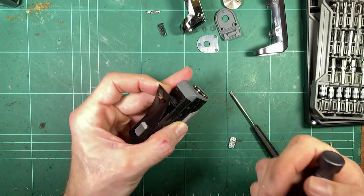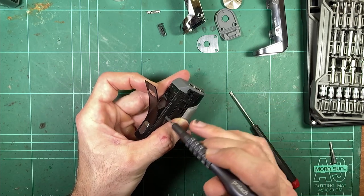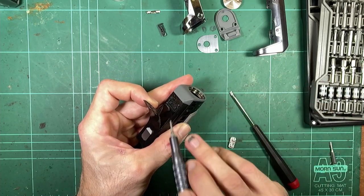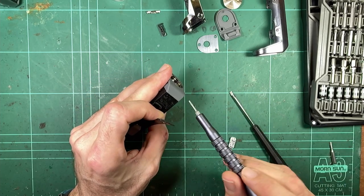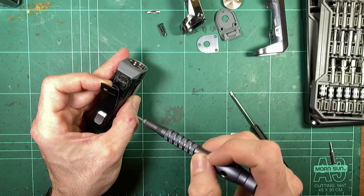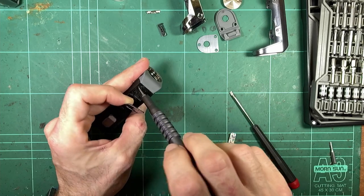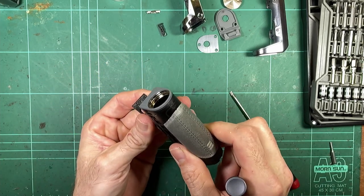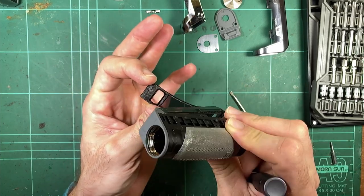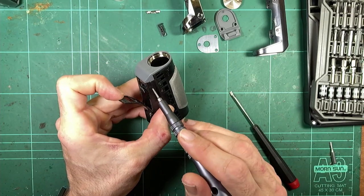Okay, keep in mind that if this plate is not sealing to this outer plastic, if you get liquid in between them, that shouldn't compromise the seal in this case, just like the original Legend, where you could get liquid under the outer cover, but it wasn't actually going into the device. It wasn't through the main seal to the board. It looks like the same thing in this mod, where you could get moisture and liquid sort of get through that adhesive foam and then find its way in between this screen.